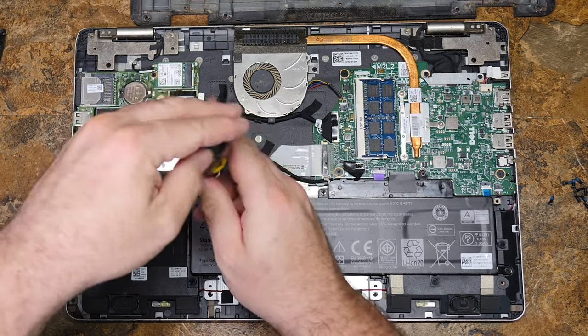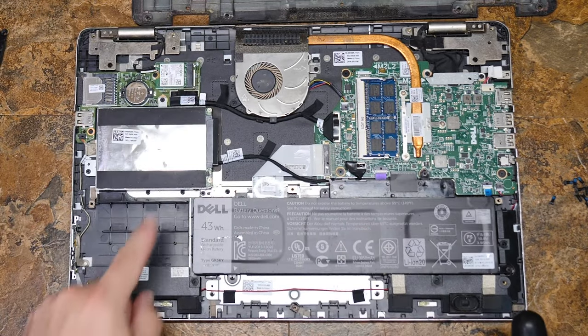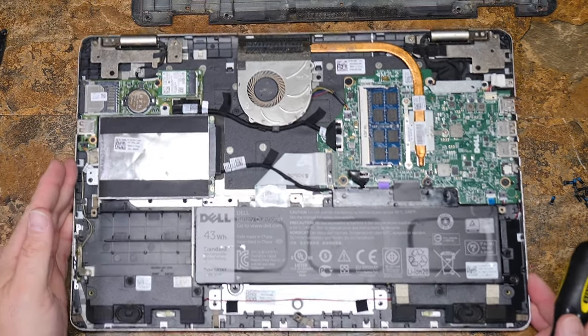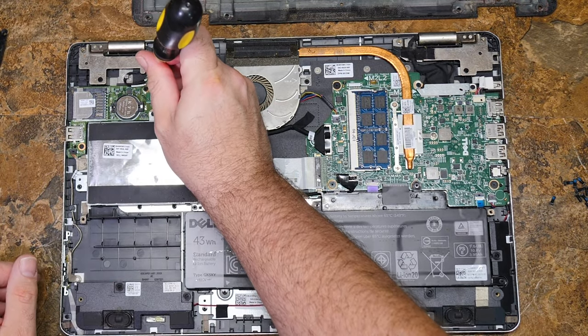It's very easy to find the holes and put everything back. There's a little alignment pin right here, and that will get you your hard drive in and out for a possible solid state drive upgrade. If you are upgrading the Wi-Fi card, it is right here — just one screw.